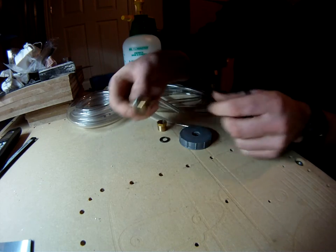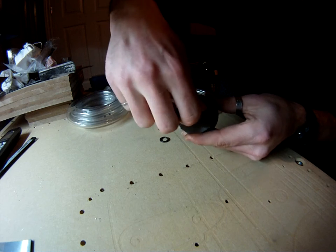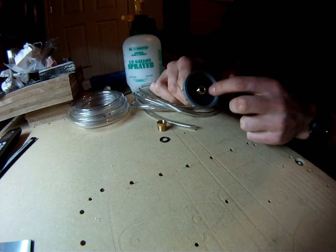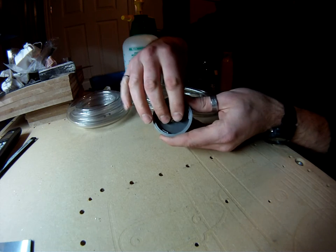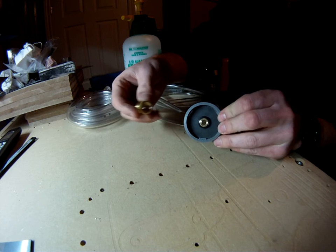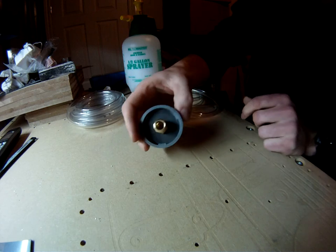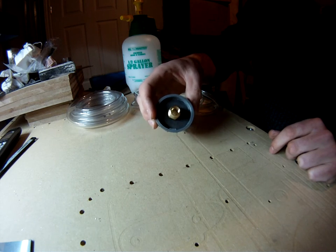First, you're going to slide the washer over the top. Then thread that fitting into the cap until it's snug. You can see it's sticking out a little on the other side. The cap actually has a little gasket in there that I've also drilled a hole in. After that, fit the O-ring over the top. Finally, take the female fitting and thread it over top to compress the O-ring and provide a nice tight seal. This system is going to be under pressure, so you want everything tight with no leaks — the last thing you want is to spray brake fluid everywhere.